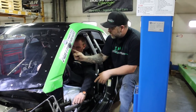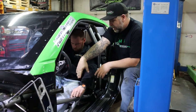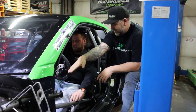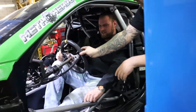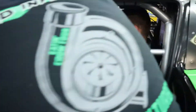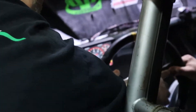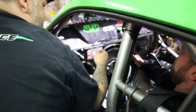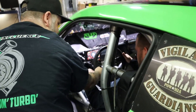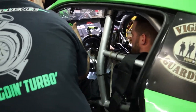So when we're making a run, the green button right there is your trans brake — you hold that in, and then that's when we floor it. Please don't floor it right now because it's carbureted, but yeah, you grab the trans brake, floor it, it builds boost and starts banging. Then you hit this button — you don't hear it, it's actually pulsing a solenoid down there and that's staging you in. While you're holding the green button you bump, bump, bump, then you wait, watch the lights come down, and boom — you let go, it goes down, it'll shift for you, and then right at the end you hit this button and that's the parachutes to pop out. We do all of that from the time we let go of the button to the parachute in like 4.2 seconds or less.